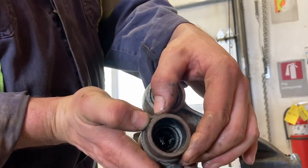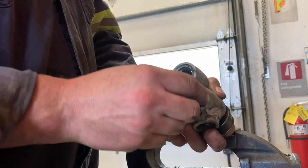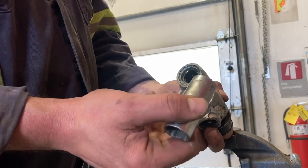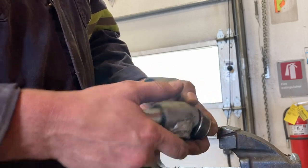That old race is going to give me a really nice surface to push on around here — big enough to let that bearing out without jamming up. And I found that a chrome 3/4-inch socket — this happens to be a Craftsman — just fits perfectly in this side.